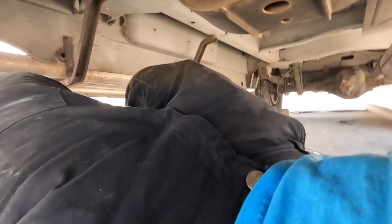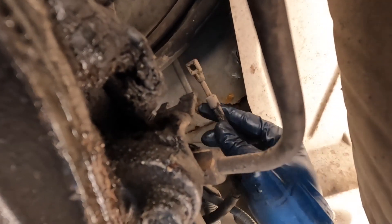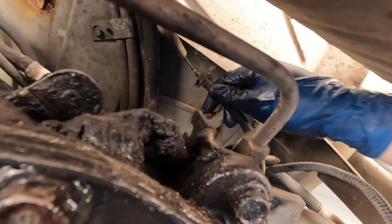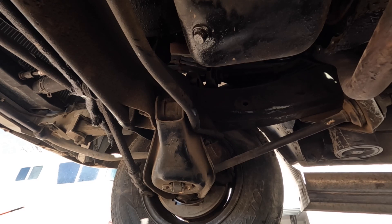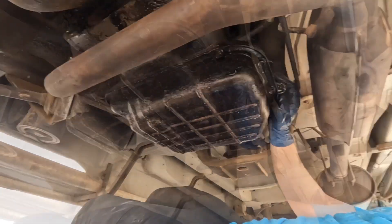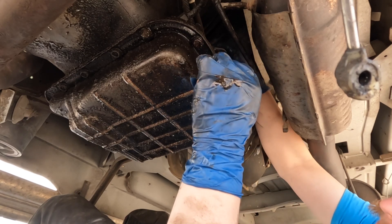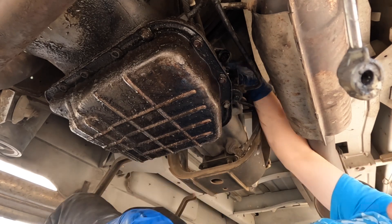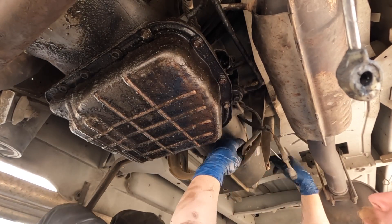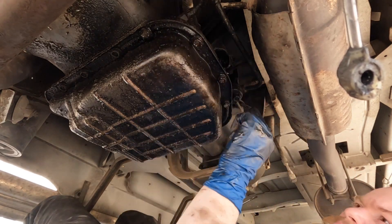Let me show you how this one comes out — it just slides right down through that hole, so you just push it and pop it straight out. There are wiring harness connectors up there to disconnect. There's a connector right here that just pries right out, and then there's another connector way up in there with a little clip on it. Now the last wiring harness connection should be this sensor right here, but I'll remove it when we get the cross member out. Let's get the trans cooler lines unbolted and then we should be really close — just need the bell housing bolts and the cross member.